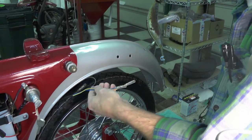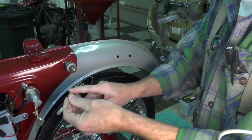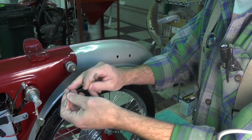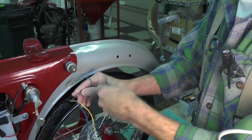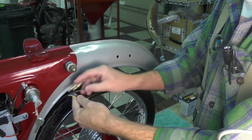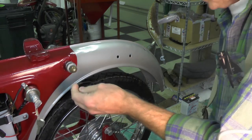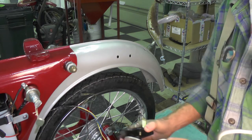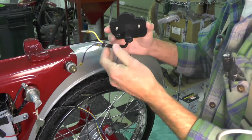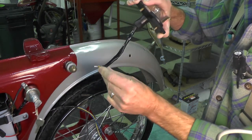The wiring harness for the motorcycle does not have an earth wire. The blue and the yellow here are for the tail lamp and the brake lamp respectively. These two wires — the green and the brown — are for the turn indicators, which are not used on this bike, so those are not even in consideration. Since this assembly is electrically isolated from the current flow, that's clearly why Yamaha provided this grounding wire right here.